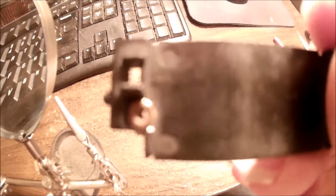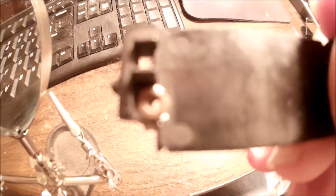those little tabs I told you about that you need to bend up, that was a separate problem. It's got a brass rivet holding it to the card, and it seems like they wound 3 or 4 strands on it first. Well, probably wound the card first, and then riveted this little tab thing on, because 3 or 4 of those wires were under the little rivet there, and I had to cut them off. It's as clean as I can get it. They're just going to have to overlap on that.